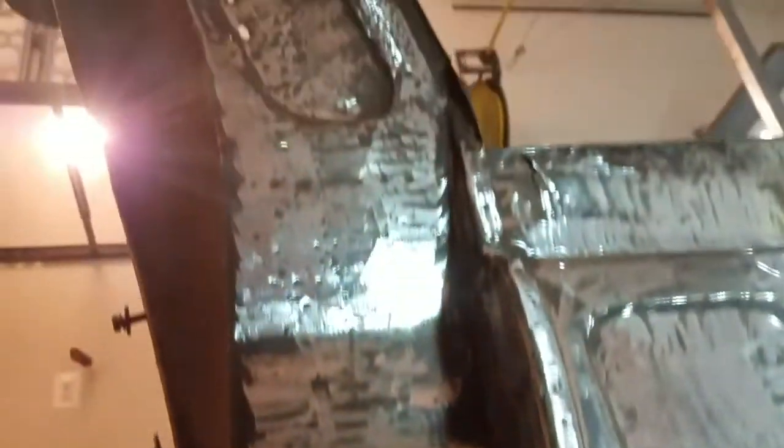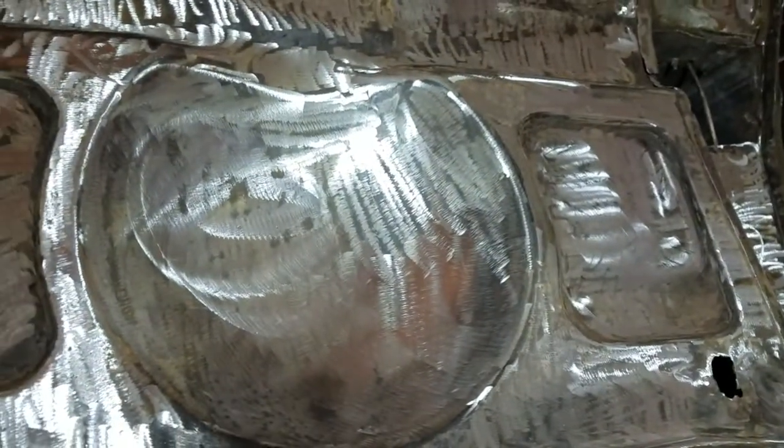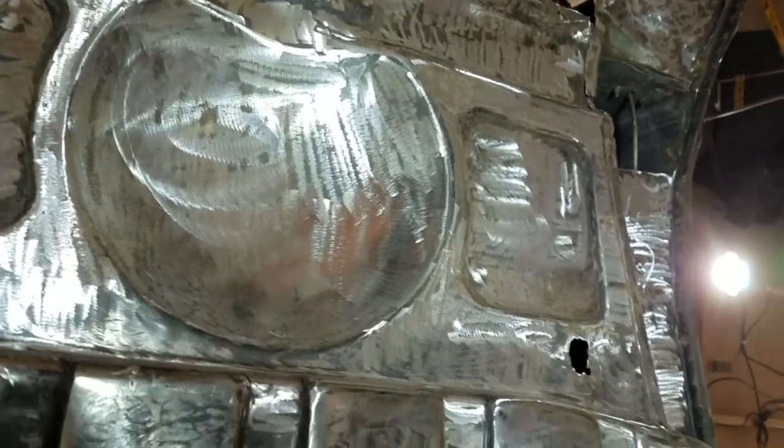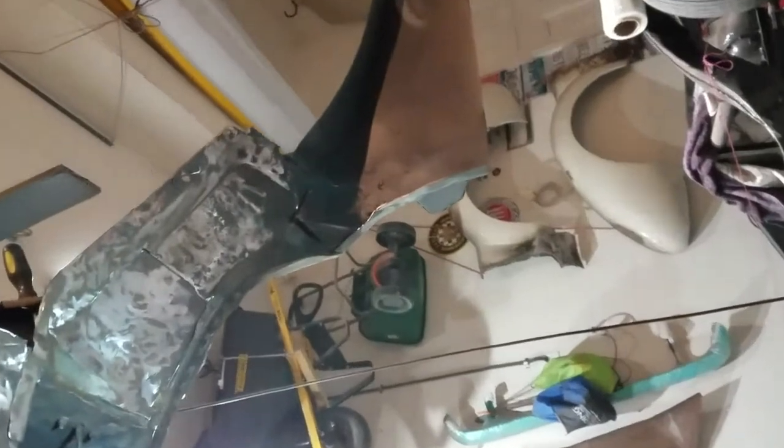As you can see, a couple areas still to clear with the wire wheel, but I like it here overall. Not too bad, but I really need to redo that area with the wire wheel too — that area there is like crap. The bowl, I call it, looks pretty good. What looks like orange spots in the center on my camera is just discoloration. I'm gonna take my sandblaster to this area and the opposite side, just to get all that junk out and recoat it with some decent epoxy primer.